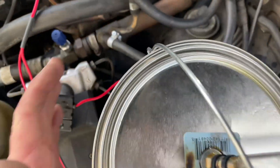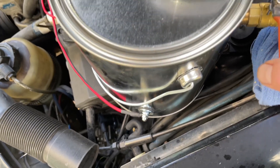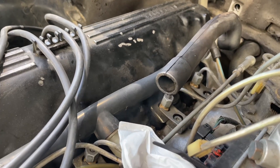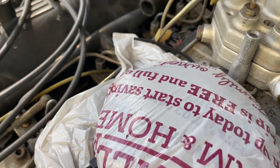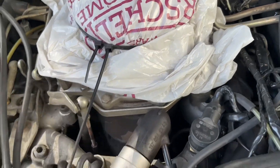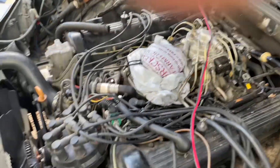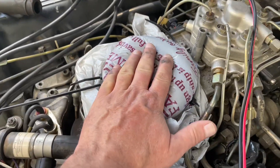The bucket gets very hot so you have to be careful. It's not the best setup but it works. With the little release valve you can nicely control the entire flow, and the reducer is very helpful. You can see the smoke coming out from underneath the intake — all coming out from there. If you go full bore it also comes out of the throttle linkage since that's not sealed here. But the usual culprits are all sealed. There's actually too much pressure for this test — we should reduce it.